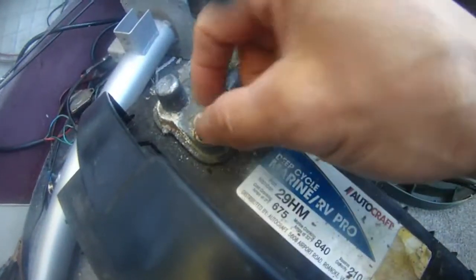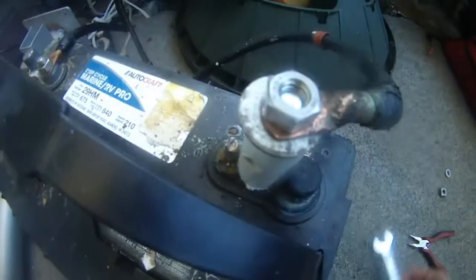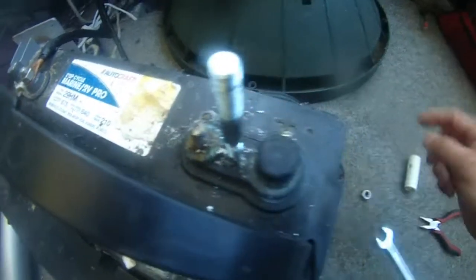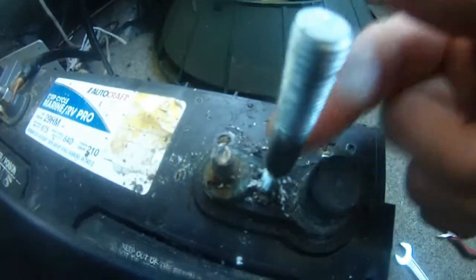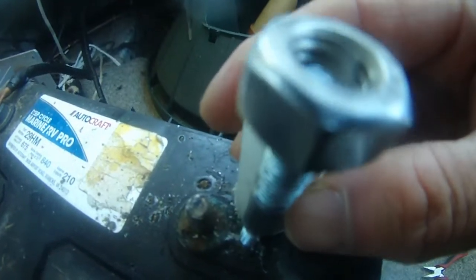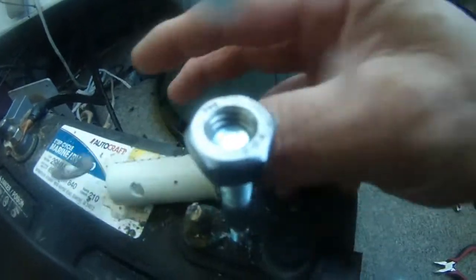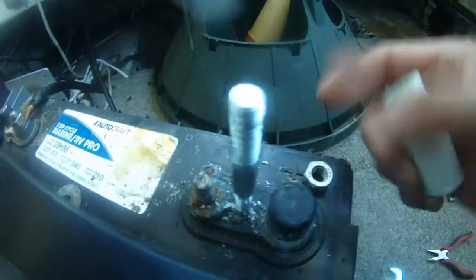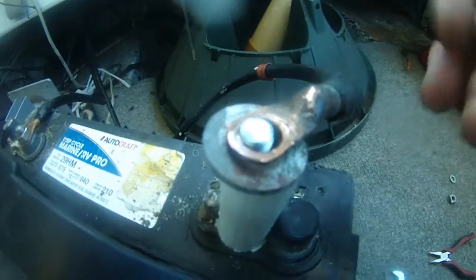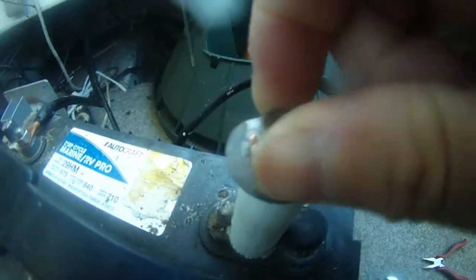Because the stud was broken away, I have to implement a fix. What I did: I have this long stud — it's sharp on one end, and on the other side I can just screw it in. But the nut is not gonna go all the way down, so I have to create a spacer for it. I put a PVC pipe here, put the washer here, then put the nut, then the connector, then another nut, and just lock it in like that.